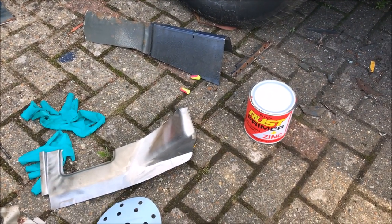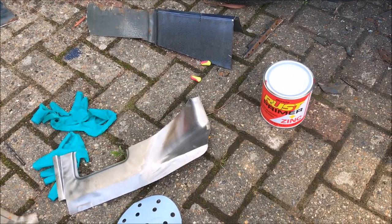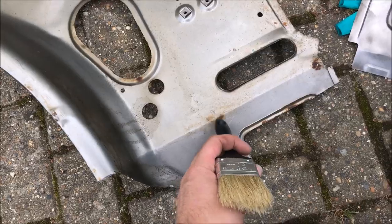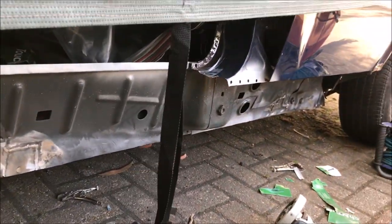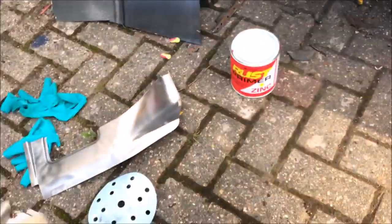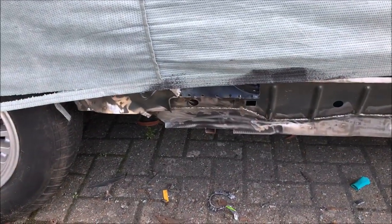It's also a lot cheaper than the Jotun 87 I've been using. I think it's less fussy about what surfaces you put it on. But even so, I've degreased it because it came with all of the original delivery wax. Then I'm going to rough it up a bit with some sandpaper. The plan is to cover all of that with the rust primer tonight and the back side of that. Then tomorrow I can sand off where I need to back to metal, weld it on, give it another coat of paint, and while that's going off, I can prep the sill for going on.